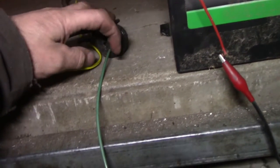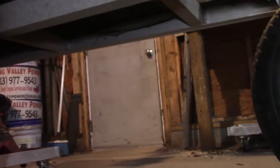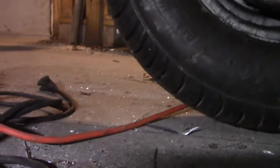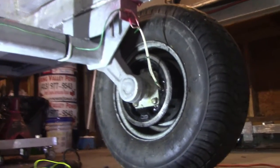So we've got a little makeshift setup acting like the truck is hooked up — the electric brake wire running to battery positive, battery negative, and just touch something metal on the frame. Both brakes should work. I can hear that one. I can hear the other one. You can spin this — yeah, there's brake drag. I can hear both of them and I can see both of them working. Both sides are all buttoned up and we just tested it with the battery — everything is wired tight.